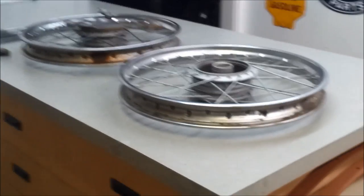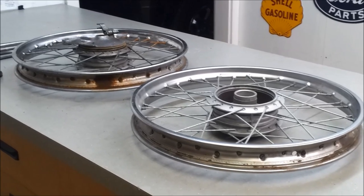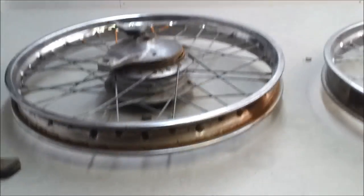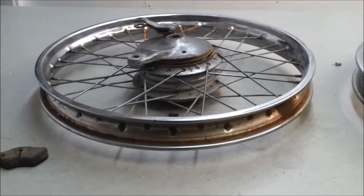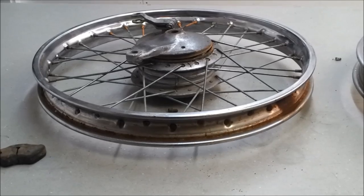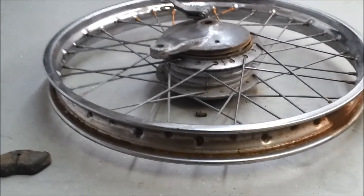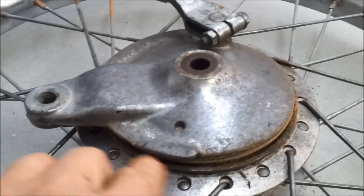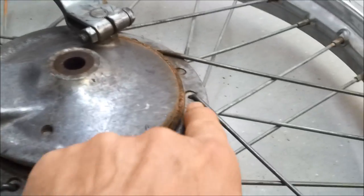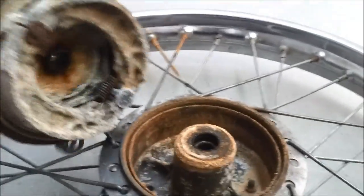I thought I'd take a minute and show you a couple of things I've learned about these rear rims — or front rims, whatever you get from a salvage yard or off eBay that are old 45-year-old rims. This rim is all cleaned up, but this one isn't — this is pretty typical of how they might come from a wrecking yard. This particular rim didn't have a tire and tube, but I've bought others that did. It could take you a couple of hours to get the old tube and tire off because they get frozen to the rim and they're hard as a rock. I had to cut a couple of them off. If they have this hub in them, sometimes that can get frozen in there. Once I got this apart, you can see how typically the inside looks — all corroded and shot to hell inside.